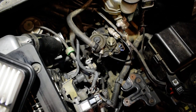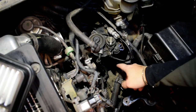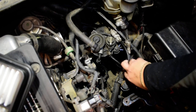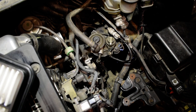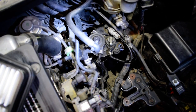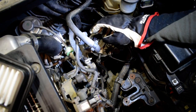I also have to remove the fuel pump — that's two screws, two clamps, and two cables. What you need to keep in mind is that there are also two hoses, not just two cables.